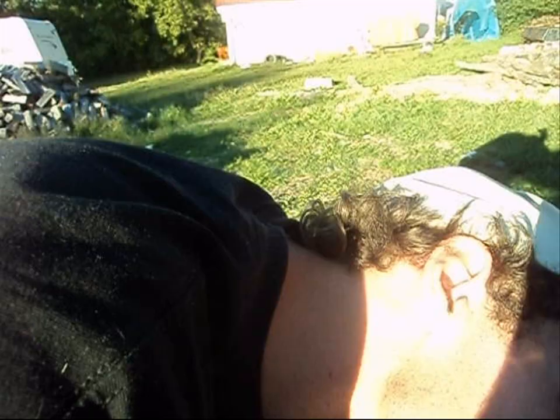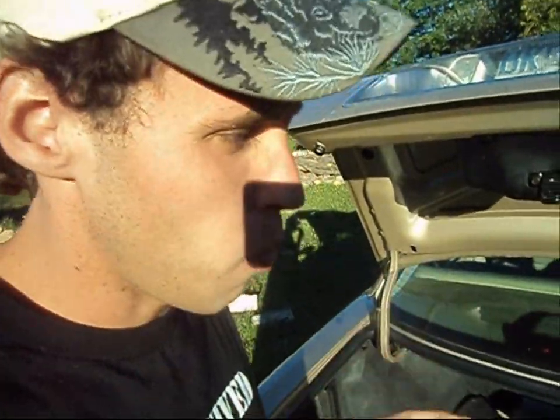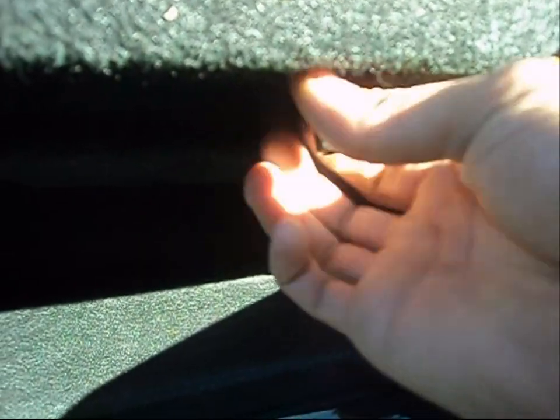What you're going to want to do is locate where your receiver is. Most of them are in the trunk; there are some that are under the dash. Mine is located behind this panel here. The owner with the problems had a 94 DeVille as I recall — don't quote me on it. You might have to remove some trim — there are little nuts and bolts in place. Go in there and start removing them; I'm counting four total. Undo all of them and you'll find your receiver.